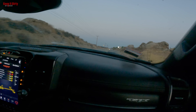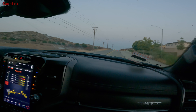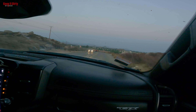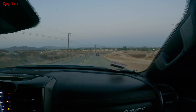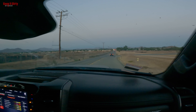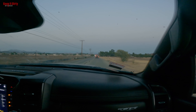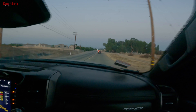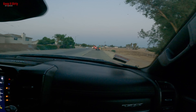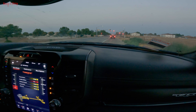You can feel the suspension doing its job — cushioning everything and keeping the truck level. I read about the strategy this thing uses to stay level at speed, but actually feeling it is completely different. You can feel the suspension doing its thing while it stays perfectly level — it's a trip, almost like you're floating. A lot of guys talk down this truck because it has 2.5-inch shocks, but the real strength is the valving strategy they use to control those shocks. Eventually I'll upgrade them, but from the factory, straight off the floor, it's great.